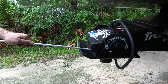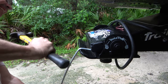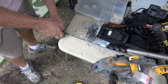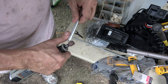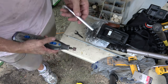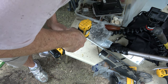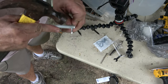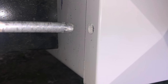I started working on the locking pin by bending a 90-degree angle into a three-eighths-inch aluminum rod, using the pin box since I don't have a vise on the RV — the aluminum is very soft and bends easily and won't damage the pin box. I made a six-inch mark on the rod and cut it with my Dremel, though I could have used a mini hacksaw. I finished the ends using a barrel sander on the Dremel to shape them for easier entry into the holes, and created a small flat spot on the side to make it easier to drill the one-eighth-inch hole for the locking pin. After drilling, I test-fit the hitch pin to make sure it goes in easily and holds snugly.